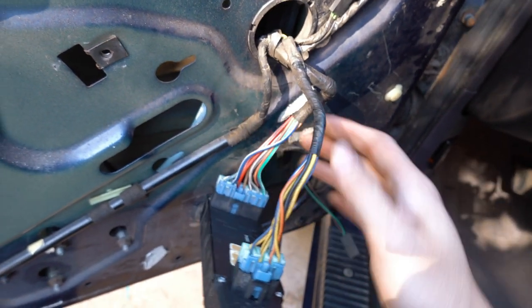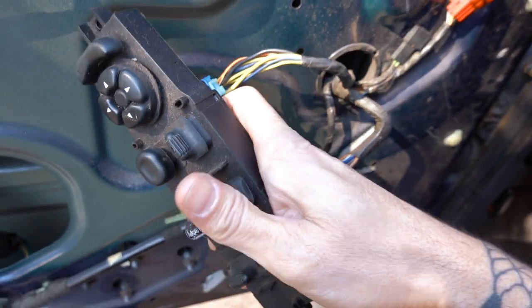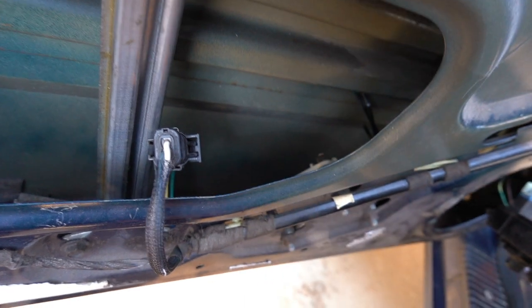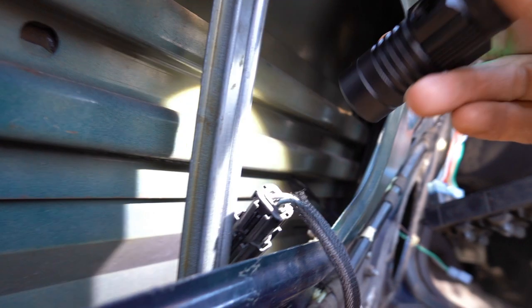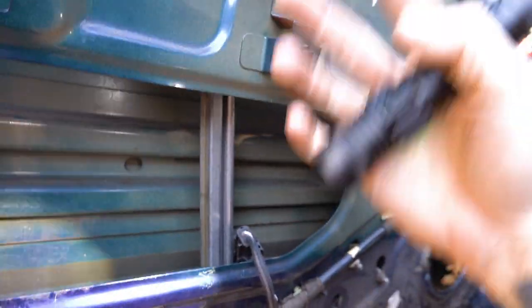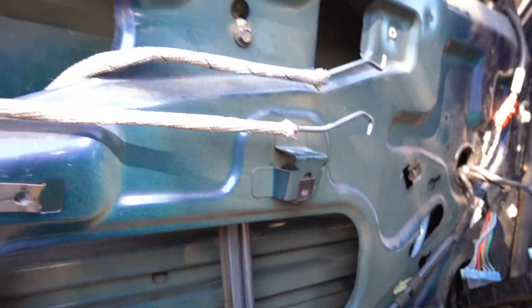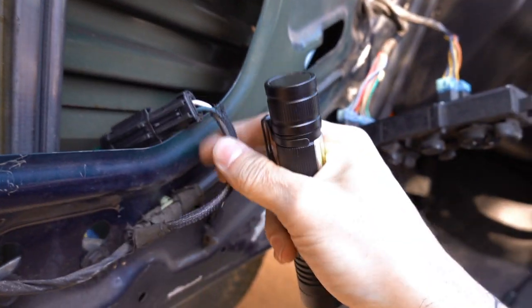This one looks good — it's never been worked on, it's just really old, and the wiring is all here. I pretty much know the wiring works because the other windows move okay. My next step is to follow the wire into the door and look for the window motor, which is located down inside the door right there. Let me get a flashlight. Your window motor on this car is right down in here — this black thing right here.